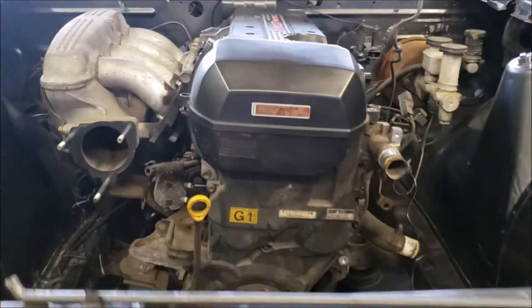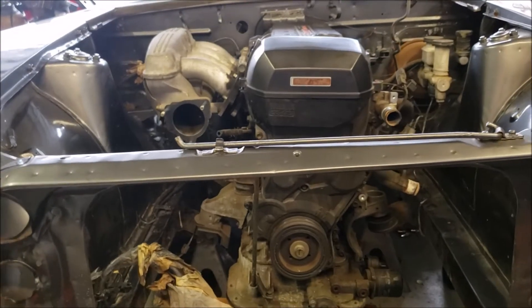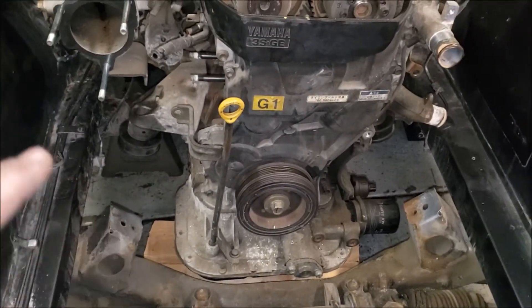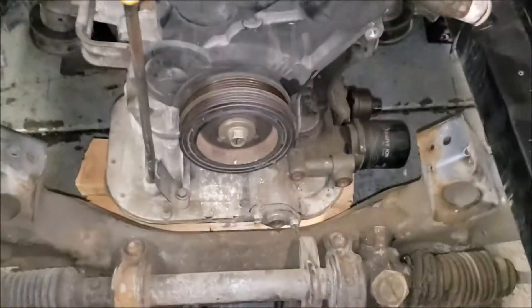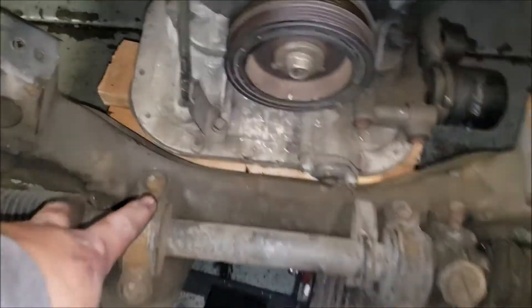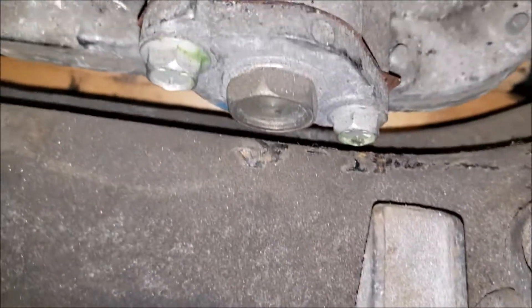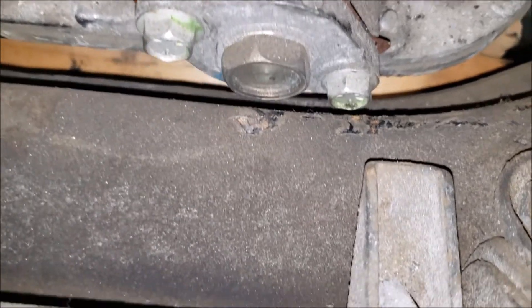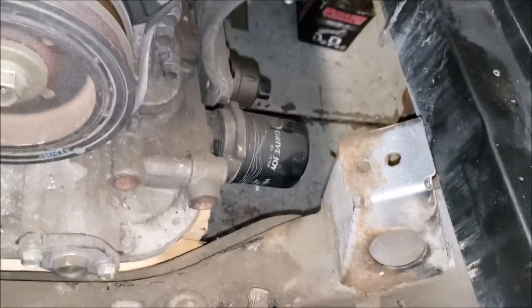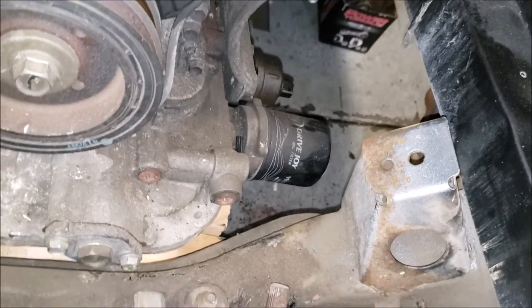Alright guys, let me bring you up to speed - we finally figured out what we're going to do about our rack and pinion and factory cross member and lower control arm. As you can see where we currently have it mounted, it clears the motor perfectly. There's plenty of room, it does not make contact with the oil pan, and we can fit a couple of papers in between there. We also have access to our oil filter - I was afraid we might have to relocate that, but it looks like it's going to work out fine.